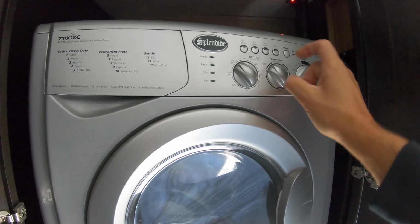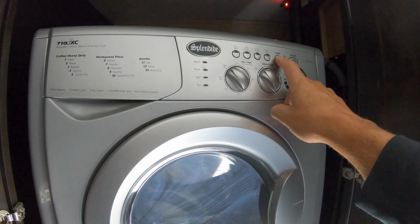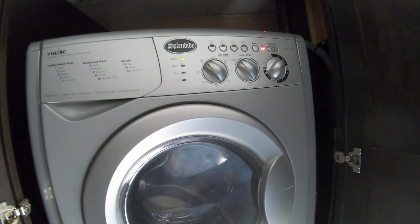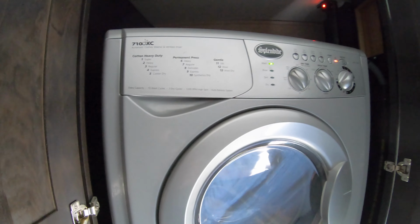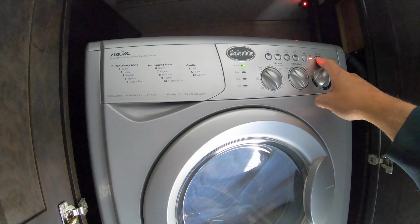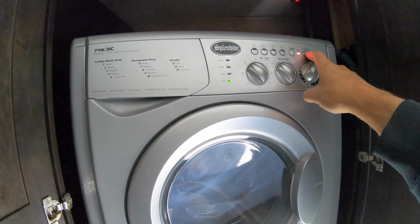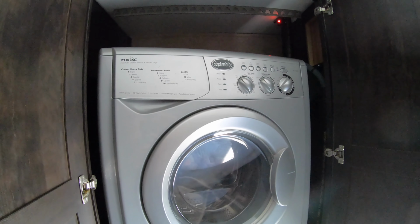Turn it off. This time go to the cold side. Start it. Turn it on. Start it again. And you can hear that it's actually blowing all the water out of the lines. Now, we're still gonna put plumber's antifreeze into this. Hold it. Turn it off. Good, so we're just gonna leave it at that right now until we flood the system with plumber's antifreeze.